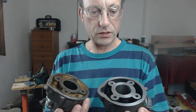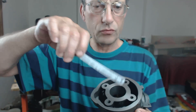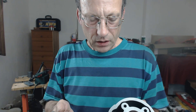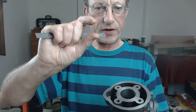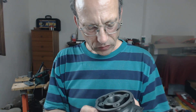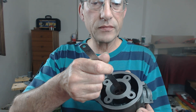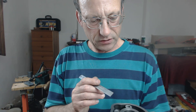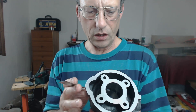The first thing is that the height of the ports from the cylinder head to the beginning of the ports — that's the same. However, they're deeper by 1mm, so they're just a little bit fatter by 1mm. While there are some minor differences between these two ports, one's small and one's larger, it looks to me as though that 1mm extra means that these ports are just slightly larger — a small amount.